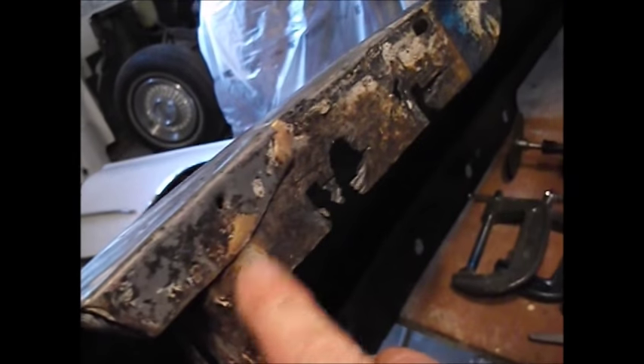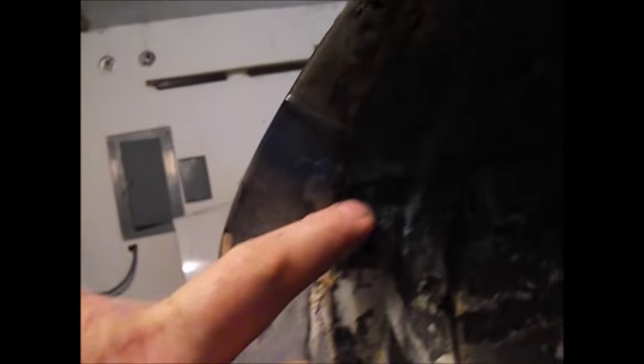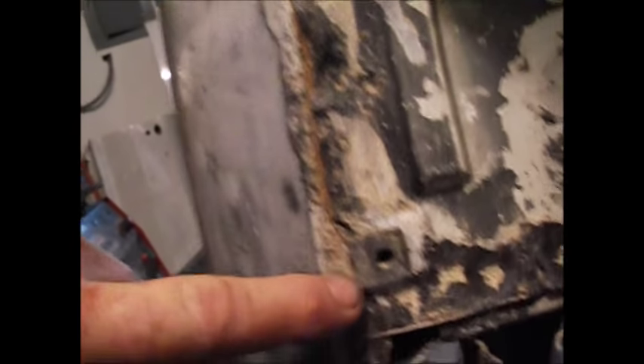We have some spot welds here to take care of. This inner bucket — there's a big hole right here, so I've got it marked where I can cut it out. We'll cut this part out and this part will get replaced. I'm going to do my best to save this part because I have these bolt bosses, these little screw bosses, and you have this eyebrow trim that goes in here. It's real important to have those exactly where they're supposed to be. There's one missing here, but once I get these in, I'll know where the missing one goes.